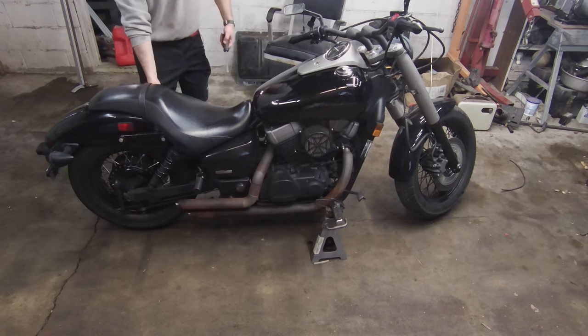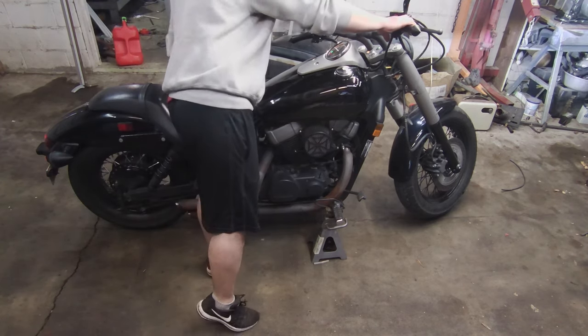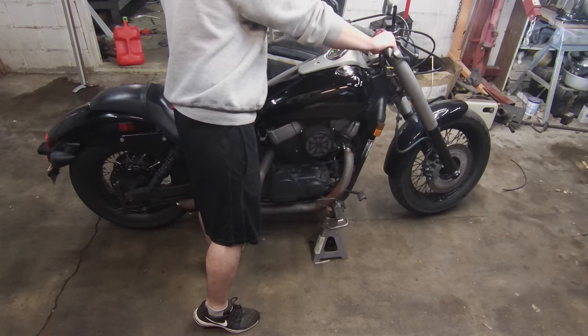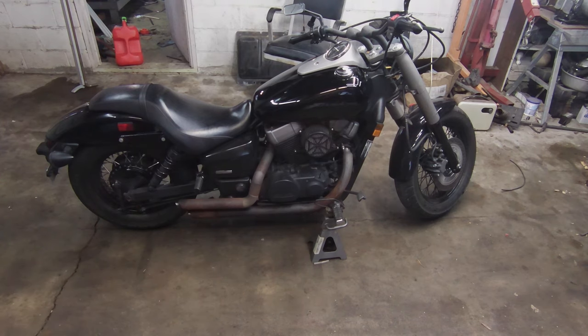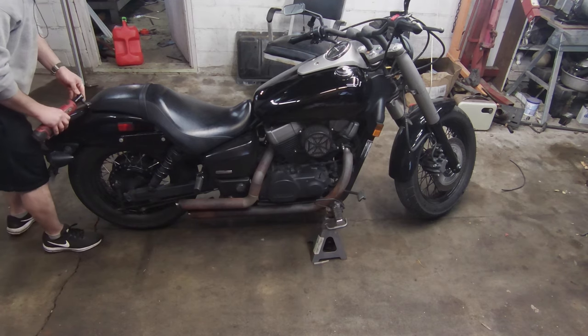What I've been doing is riding this bike until the fuel light came on. It's just running really rough, and when it is warmed up the bike just doesn't have a lot of power, which is why I think it's a fueling issue — and we've had the fueling issue before. This bike sat for several years before I got it with fuel in the tank.